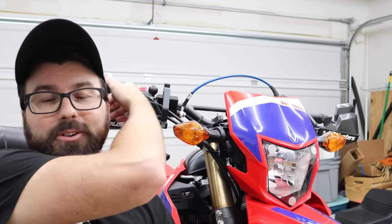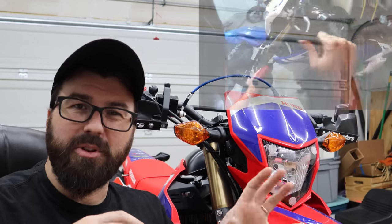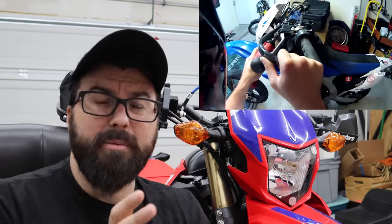You saw the last video — I took a little bang on this side. It was somewhere between a drop and a crash. A crash shouldn't bend your bars, but in this case it did. I rode home with that crooked bar. When I got home I did the normal thing of loosening up all the bolts on the triples, the axles, and the pinch bolts, and gave everything a wiggle. Normally that method almost always fixes it — the forks are slightly twisted in the triples — and I was sure that's what I had. But as it turned out, no.